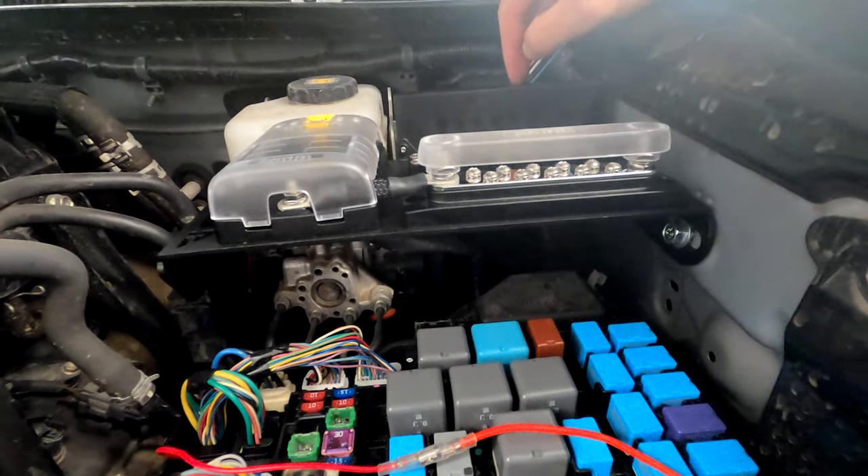Switch Pros pre-drew a 45-degree bend on the ground cable because it's going to run up through here and conveniently attach onto that ground spot. They recommend hooking up this side before the other. I'm going to get this 10-millimeter nut off and snap this on top. I decided to run the ground cable behind this plastic support for the fuse and relay box to keep it back and out of the way, especially so I don't have to fight the cover going back on.